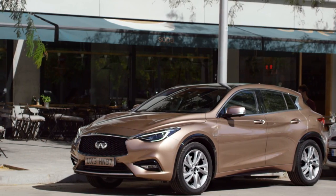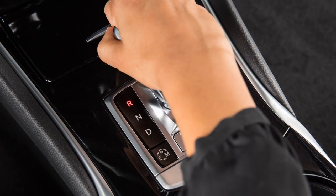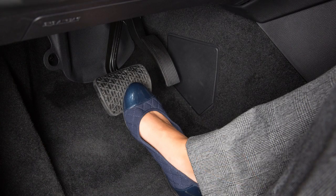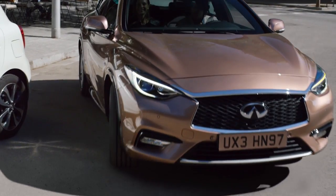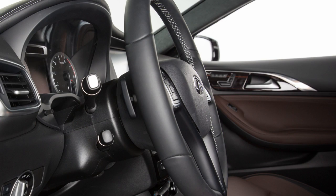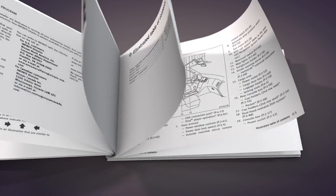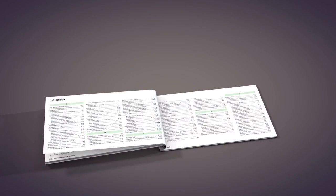Slowly drive the vehicle forward until the Park Assist Active Select R Observe Surroundings message appears. Stop the vehicle and place the shift selector in reverse. If the message Park Assist Active Select D Observe Surroundings displays, stop the vehicle and move the shift lever to drive. This may happen several times. After you have exited the parking space completely, the steering wheel moves to the straight ahead position. You hear a tone and this message appears in the display. Please see your Owner's Manual for important safety information, system limitations and additional operating information.